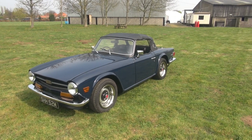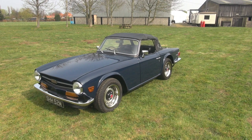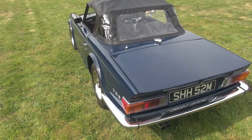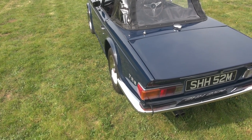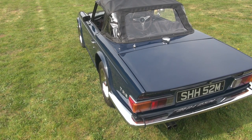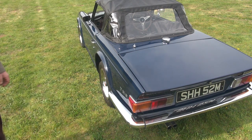This gives you an idea of how straight the body panels are. Obviously this is a car built onto a chassis — it's not a monocoque — and we do get a lot of TRs that have quite poor door fit in particular, but this one's good. You can see the very flat line of the side of the car and the very good door fit on the near side. There are tiny little pimples of micro blistering here — that's the sort of thing we need to take care of. Not a big job, and as I said, it's going to be done within the price.